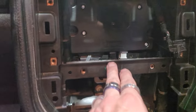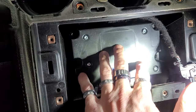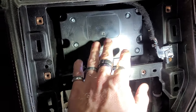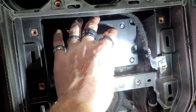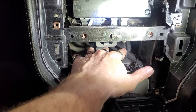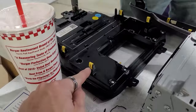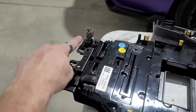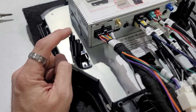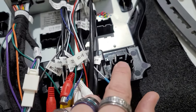His car is a little unusual — most of them do not have this piece sitting here, which could cause problems if you're putting a double DIN in because your double DIN needs to sit right here. If so, you're going to have to take these 7mm bolts off and relocate this down underneath so the slot for the double DIN is available in these factory clips. Here's the cigarette lighter and then those yellow clips go on each side and the USB we're going to try to reuse.